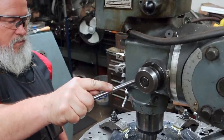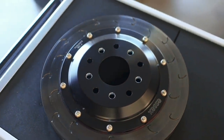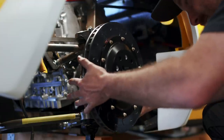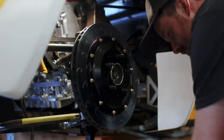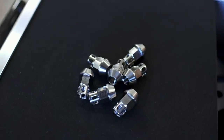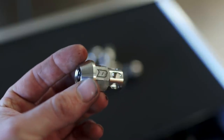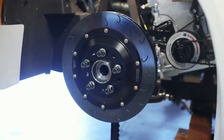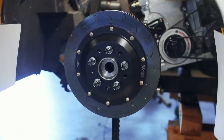As he does with everything, Brett made the entire process look easy — he knocked all four rotor hats out in about an hour. With everything wrapped up we have rotors that are both 5x114.3 and 5x120, and we can finally install them on our spindles — unsurprisingly a perfect fit. It's also an opportunity to finally use my titanium Battlecraft lug nuts, and I can only hope they're visible once the wheels are installed.